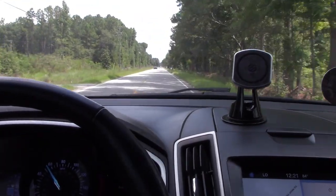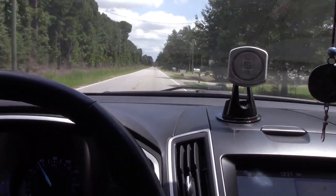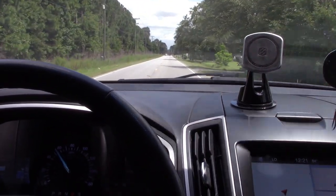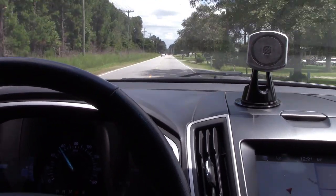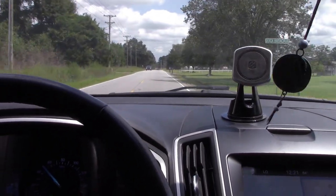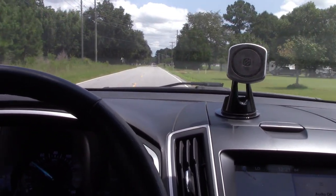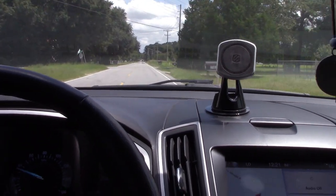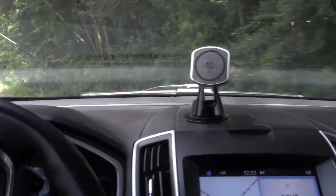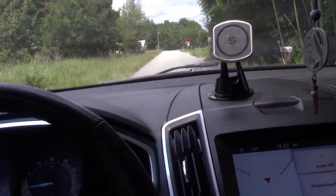I can't romp on the brakes with a car behind me. Before I turned the camera on I had sped up and romped on the brakes, and I don't get the stereotypical pulsation of the pedal like you'd get from warped front rotors. I didn't hear any grinding as if there was metal-on-metal with no pad material left. I can feel a little bit of vibration when I push on the brake pedal but nothing horrible — it's not going to shake your fillings loose. I'm going to get it in the garage and up on the lift.